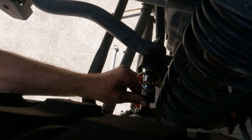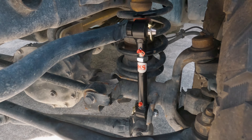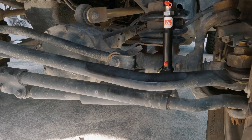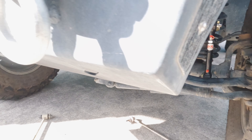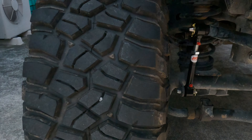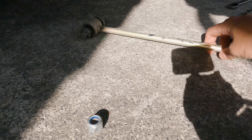That's nice and straight. Clevis pins are in — that's tight. These are done. You want to make sure these are 90 degrees for better handling. Better than what's in it now, I'll tell you. Taking these sway bar links off.